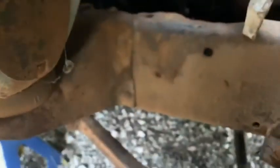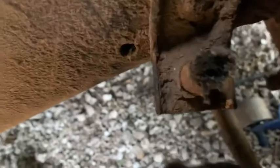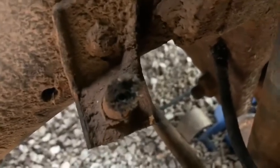Well, I'm about ready to just cut that line and see if somehow or another this wheel cylinder is holding that up. Let's see if we get some fluid this way. I'm really crossing my fingers hoping so. I think we got a little bit of something. Maybe that's just wishful thinking. Looks a little wet in there. I don't think you can see it on the camera, but yeah, you can't.